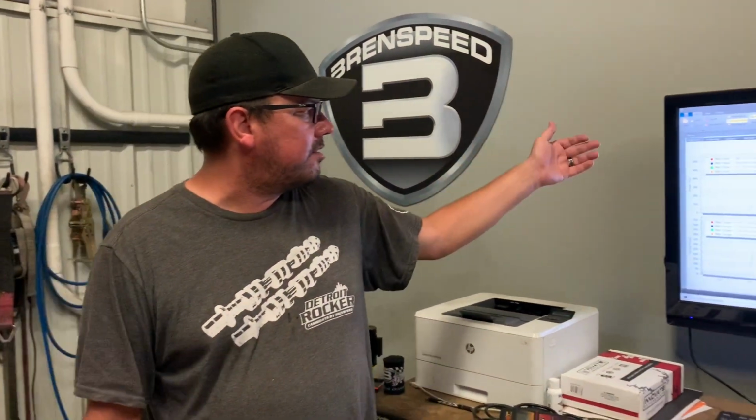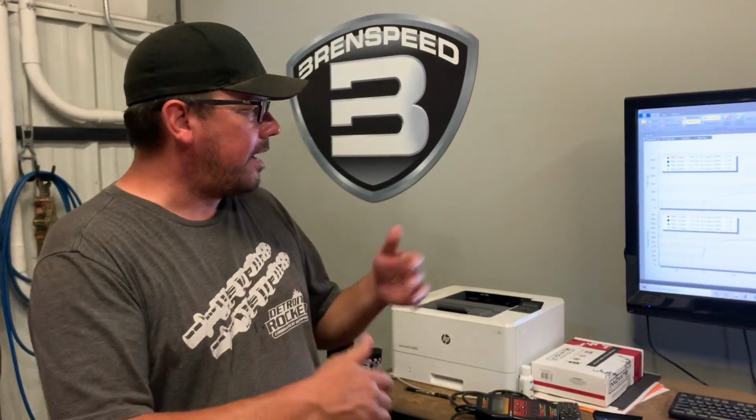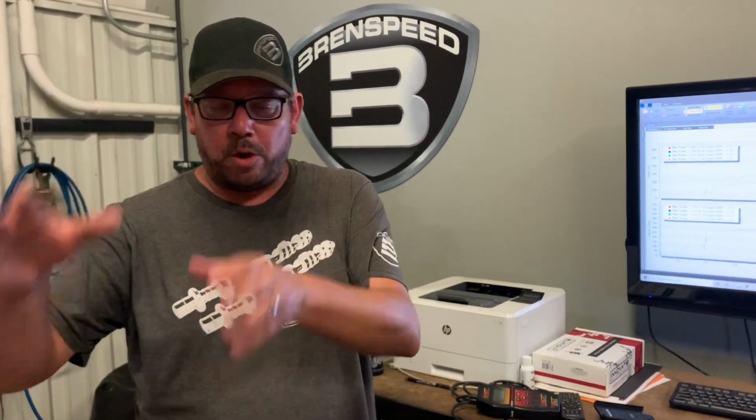So stock 364, 366. With the blower, 615, 619 rear wheel. So Roush rates that flywheel, I believe, on the Phase 2 about 727. Mathematically, with the drivetrain loss that comes in about that, I think it's a sweet setup for literally bolting it on. Roush calibrations for Phase 2 kit.